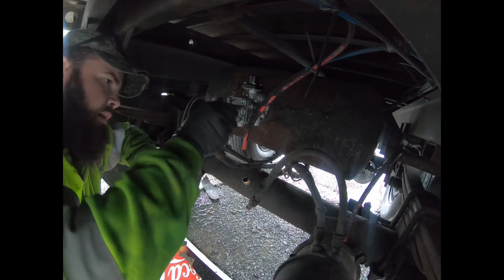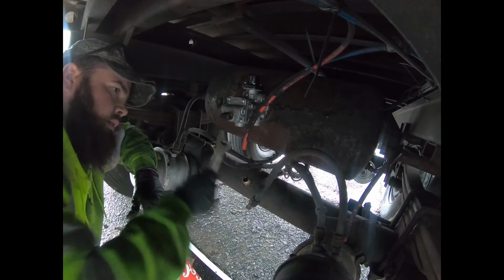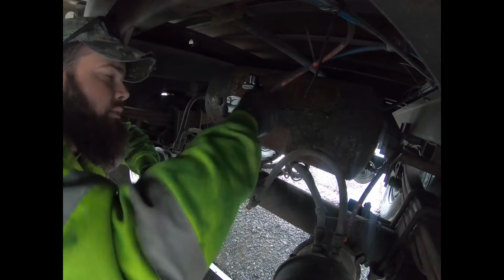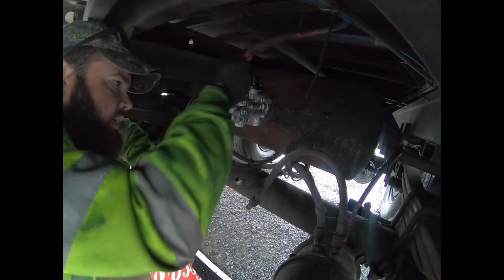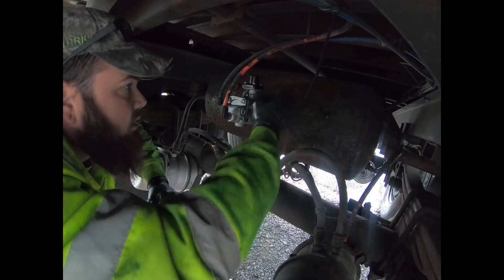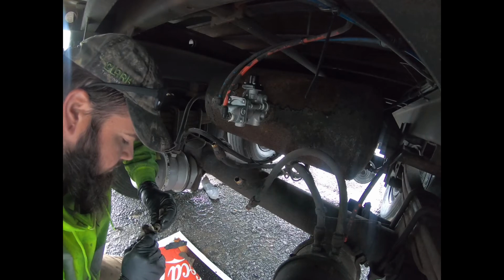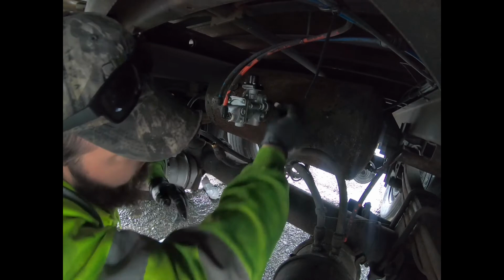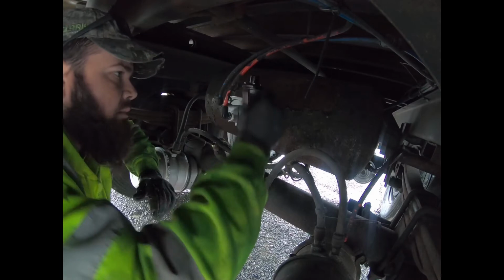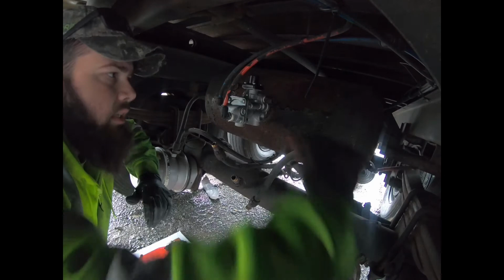I put a bit much on that. Either have too much than not enough. Okay, these two's in. Put your blue on the left, red on the right. And you can also have the trailer supply come in either direction as well. This fitting for the tank supply in. It was the oddball out of the auxiliary fittings at an 11/16. Get it up in here. Get your tank line on.